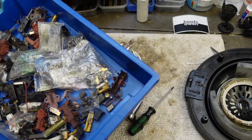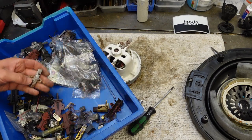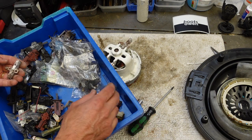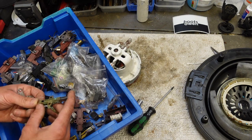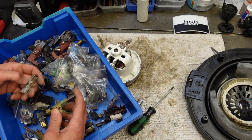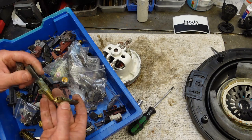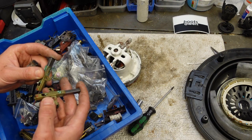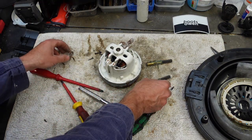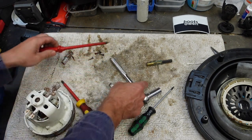So if I have them, they should be in here. Don't see anything straight away that jumps out. Mostly washing machine motor brushes. The next option is to try and free it up. Something like that, actually - that looks about right. Do I have a pair of these? Yeah. This one also has the stake come out with it - these are made in brass. That might be it. It would be wonderful if it was. These have taken the stakes out too. Now the winding wire is broken in there, I can see, which doesn't help matters.